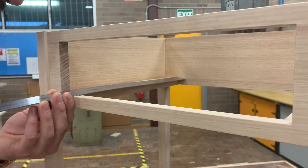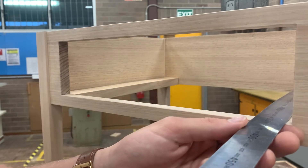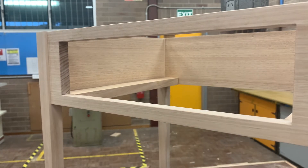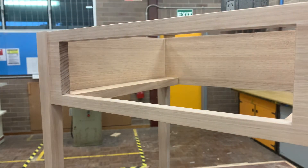My front is 353 millimeters, and I always recommend checking both sides because it does vary a little bit sometimes. So 353 for me. I'm going to change that down to 352, and then if there's an issue with it going too far back, I can just put a little blocker there of a millimeter to stop that.